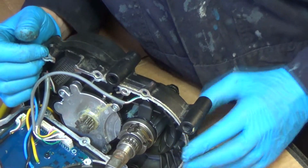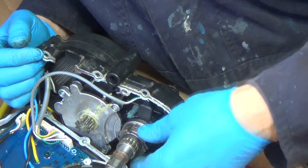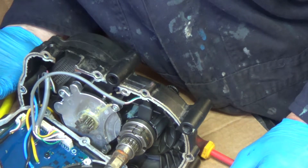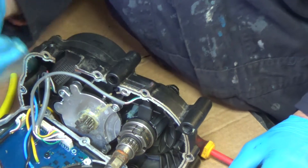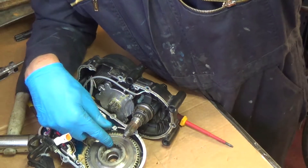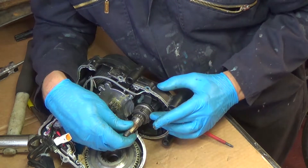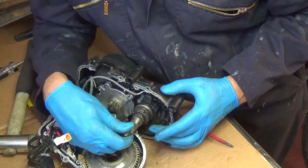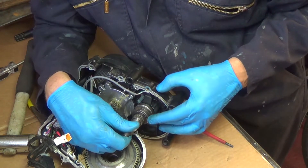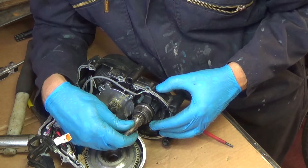And then these pawl teeth — they click down but they don't always spring back up. A few seconds later, that one's not jumped back up. So I wonder if that banging thing I'm experiencing is when these aren't jumping back up and re-engaging with these teeth in here. I might explore that a bit further. There's some kind of spring clip thing there — it looks like it's there, just not with enough force to make it jump up. Whether that's because they've got a bit sticky or the spring has lost some spring — or both — I'll have a look at that.